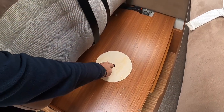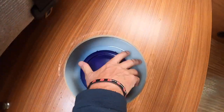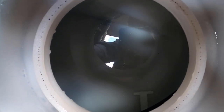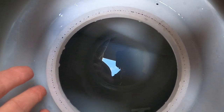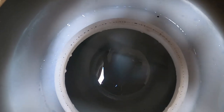Underneath the rear travelling seats is where your on-board fresh water tank is. To drain it, there's no tap outside — you have to come in, loosen the nut on the tank, and inside in the corner there's a little drain. Lift that plug up and it will drain the water underneath the chassis. In winter it's crucial that you don't leave any water on board — no waste, fresh, or any in the boiler. If this water was to freeze it could crack the tank and flood the van.